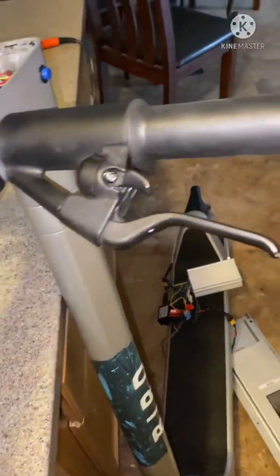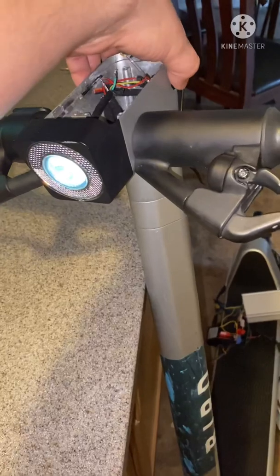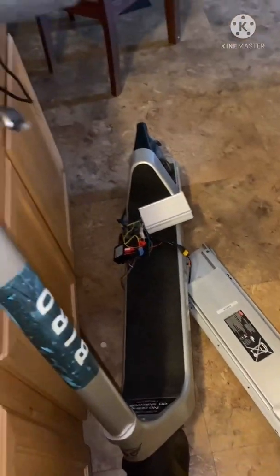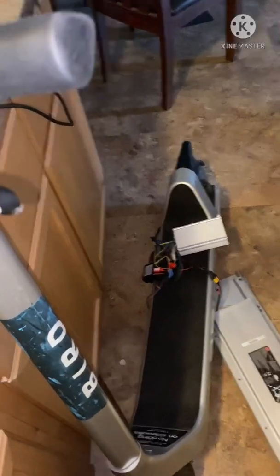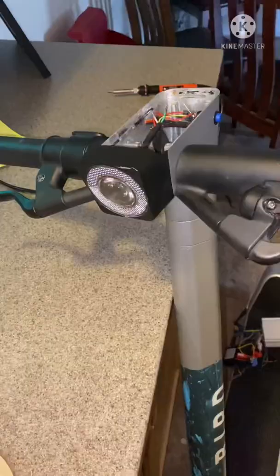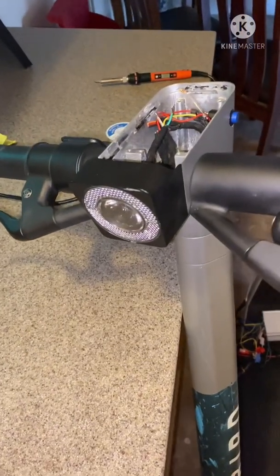Because doing that, I was actually taking power from the main system. I know that because every time I powered on my headlight, those bottom strobes would dim out - they would dim a lot. So I had to go back and take that off.